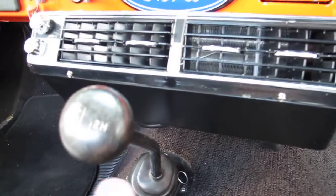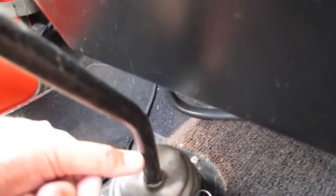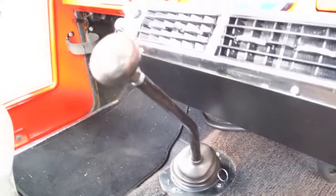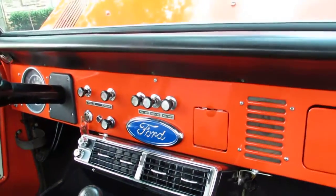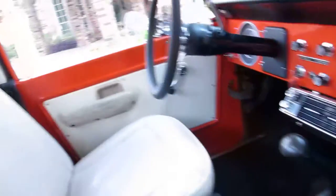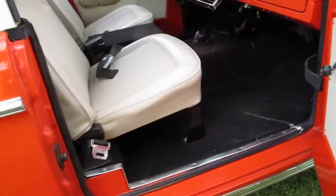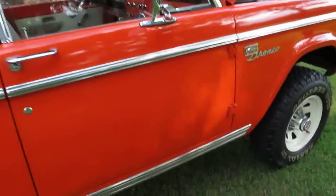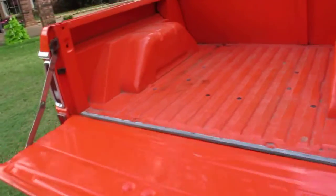Basically you can see it's in high. You've got to be able to move it up and move it forward. What you'd have to do is cut it and weld it where it clears the air conditioner unit to allow it to go forward enough so that you could put it in four-wheel drive — so that's a modification that needs to be done. It still has the windshield wiper motor cover and kind of a little felt headliner. We haven't cleaned it or washed it for this video; we're letting you see it the way we keep it. It could stand to be vacuumed out and probably could stand a little wax and polish, but we just want you to see what you're getting — we're not trying to hide anything.